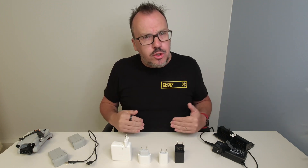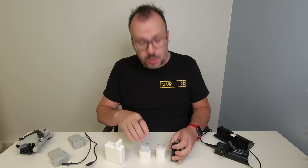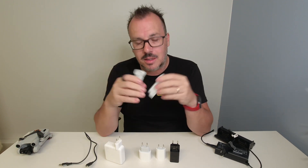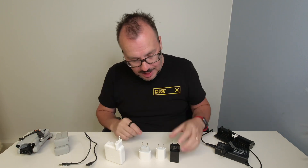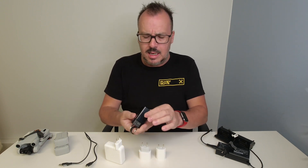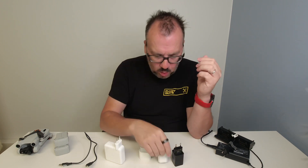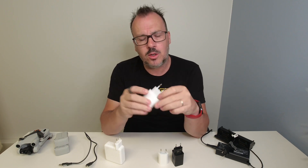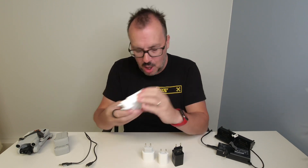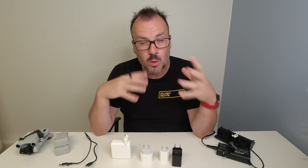When it comes to charging, what should you use? There are so many different kinds of charging bricks with different wattages. I'm going to do a test and charge up many of these Mini 3 batteries, timing each one so you can see how long it takes. I'll display the wattage of each plug. I've got a DJI plug from the smart controller — that's 24 watts — an Apple charger at around 5 watts, a 20-watt USB-C charger, and my MacBook charger at 67 watts.